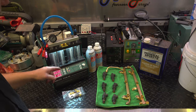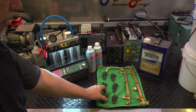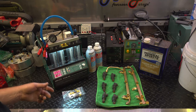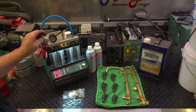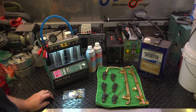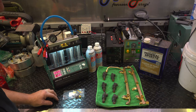For testing the injectors you're using mineral spirits in here. This is cool — it's the first time I've used something like this. I have some leaking injectors on one of my other cars, so I figured I'd buy one. They're great for electronic fuel injection, but not for CIS systems that rely on pressure to spray. The internal pump should be enough for a six-cylinder. It's all filled up — let's try it out, see how it works.